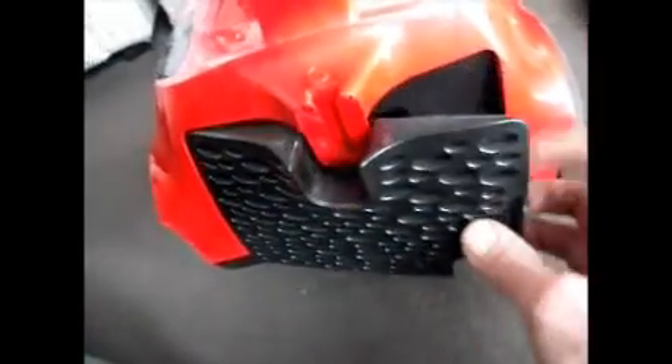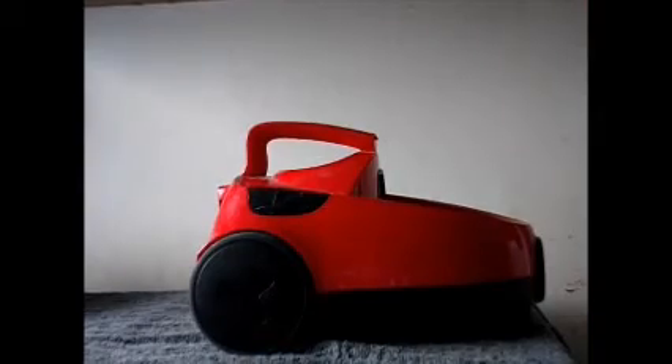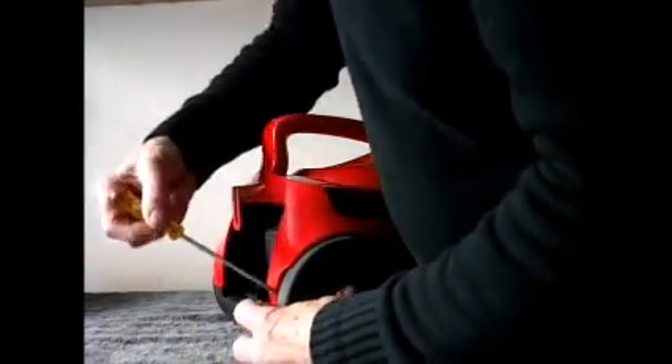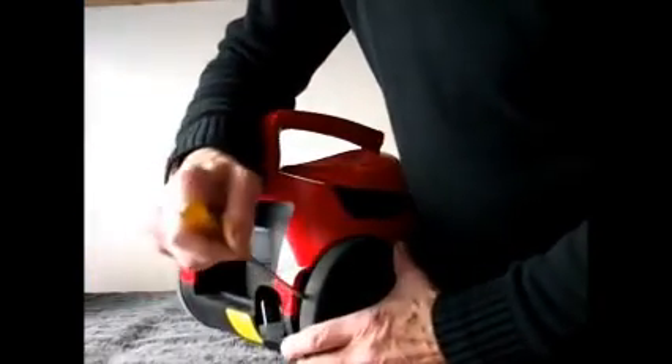You just push that in like that and away it comes. And we're going to tip the vacuum cleaner up slightly now, so make sure that you take all your four screws out of the holes inside here so that you don't lose them when you tip it up. So the next thing I'm going to do now is remove the wheels. These wheels, all you simply do is put a screwdriver or something to lever them off.